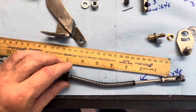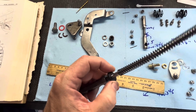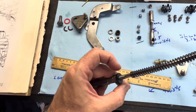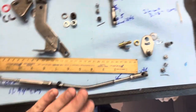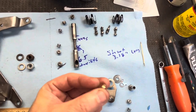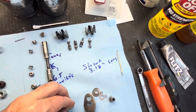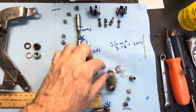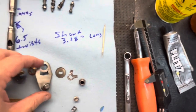The only thing that was worn out is this washer. I'm not sure if all TRs have this spring — might be just later ones — but this washer clearly showed signs of rubbing and it's a little oblong. I don't have a thick washer to replace it, so I'm putting it back on for now, but it's not as round as it should be. Everything else came up good. This is like an unobtanium bushing — you want to take good care of it. It goes in here — this nice piece, probably brass or bronze.